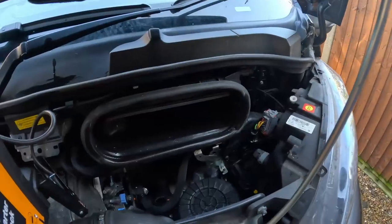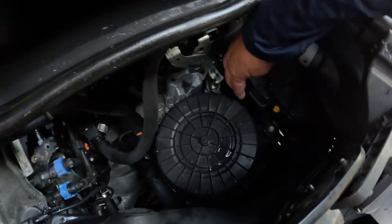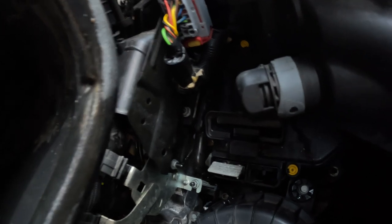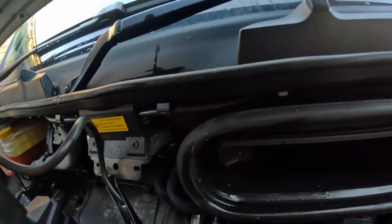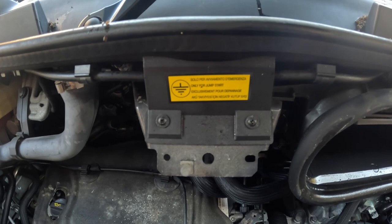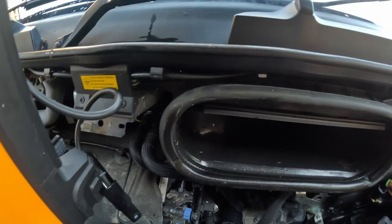Just to keep the battery topped up. If you look there, obviously where the air filter is, there's a battery cap there — just lift that up. If you can see, obviously that's your positive terminal, so that's where the red lead has to go. And then on the front, you can see that's where the negative side has to go. Really important you get it the right way round, otherwise you can end up in all sorts of trouble.